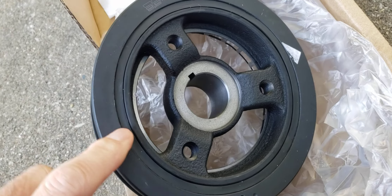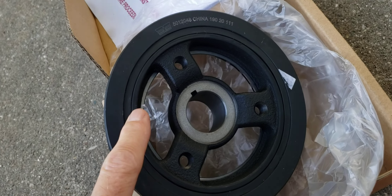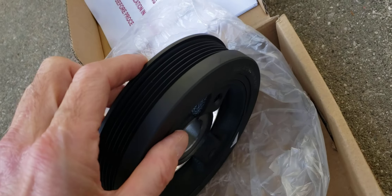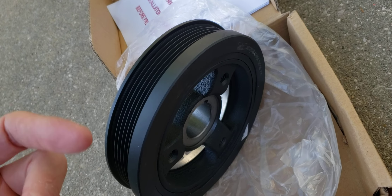What we've got on this pulley is a rubber interface between the outside pulley and the inside pulley that attaches to the engine. When that rubber fails, the outside pulley can work its way in or out, and in this case it was working its way out, eating off the side of the belt.